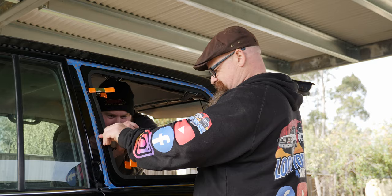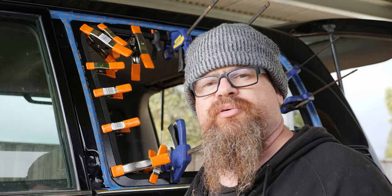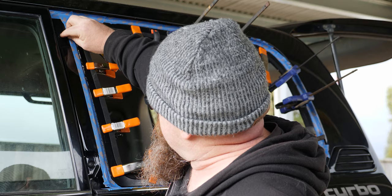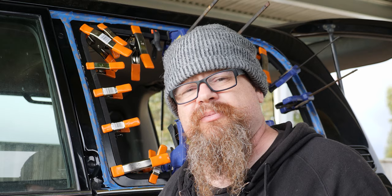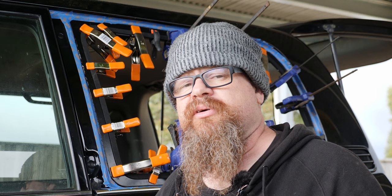There's two holes on the 102s you'll have to fill in. One here, we already put a bung in there with a bit of Sikaflex, and one up the top here. And we put a bit of Sikaflex on that bung to ensure we get a watertight seal. There is some tape supplied with it, but we went tape. Yeah, probably not. We'd rather go with a proper bung and a bit of Sikaflex to make sure 100% we're not going to get any water ingress from those holes.